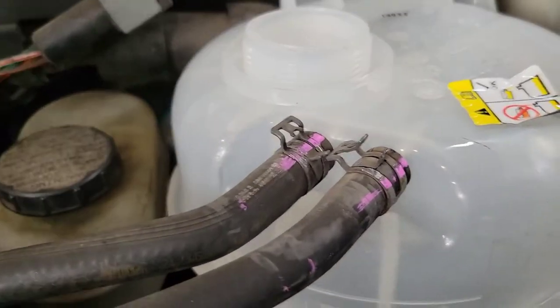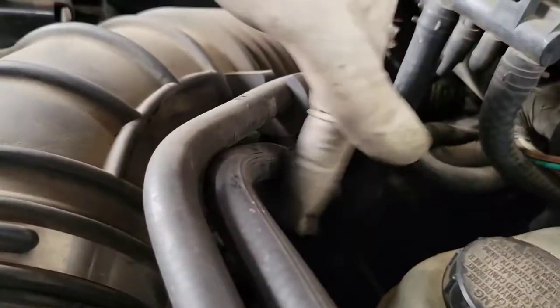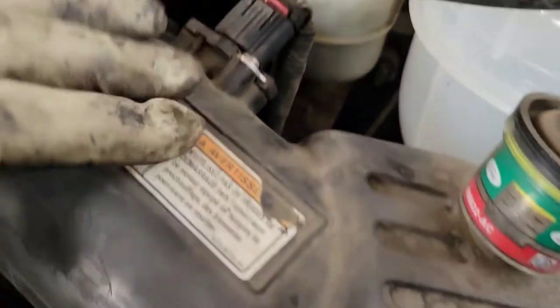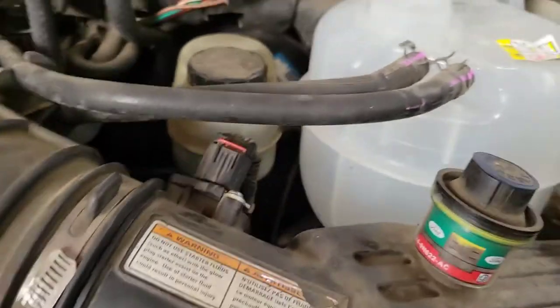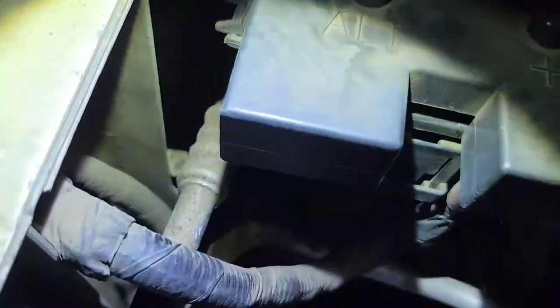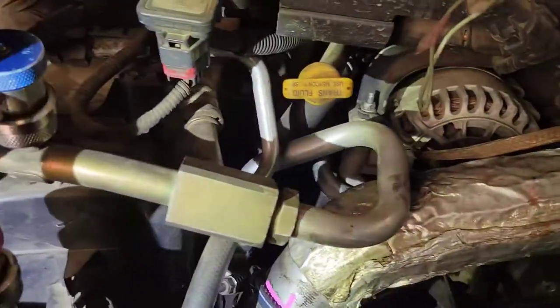Even these little bitty clamps right here — if you don't get them exactly right they'll leak. So paint-marker those, and you'll hardly have any problems. You've got to undo them from the intake tube and disconnect the mass airflow sensor. There's a clip down here, a clip there, and a clip on the other side — pop those off, lift the intake tube up, and it slides out from under the degas bottle. The intercooler hose is back on, the CAC tubes are back on both ends, and the AC lines are connected. I just recharged the AC.